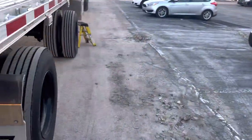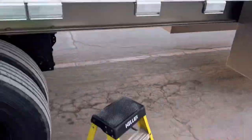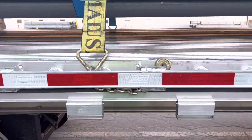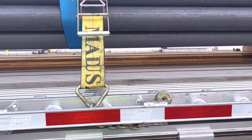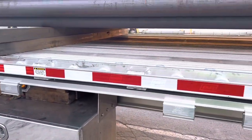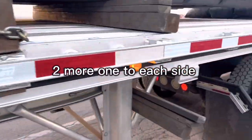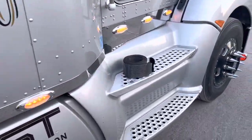I don't have any winches on this side of my trailer, so this is where my big ratchet binders come in. I'll hit a ladder to make it easier. I tuck my excess strap up under there, so that way one belly wrap's pulling one way and one's pulling the other. A lot of guys will do them both on one side — I don't like that, because it'll actually start to pull the pipe to one side of the trailer. And if it was not banded, I would put another belly wrap in the middle. Now we'll throw the straps on with some rubber things on them and I'll show you that when I'm done.